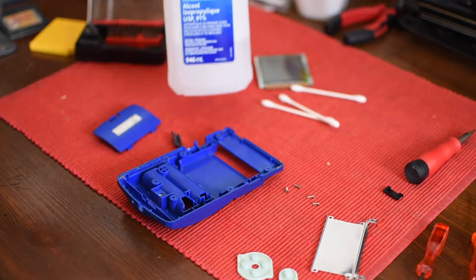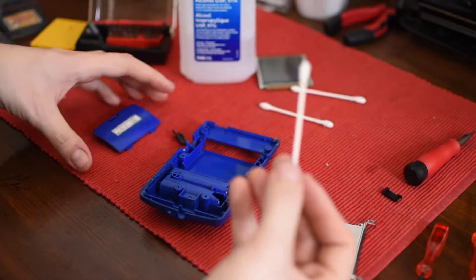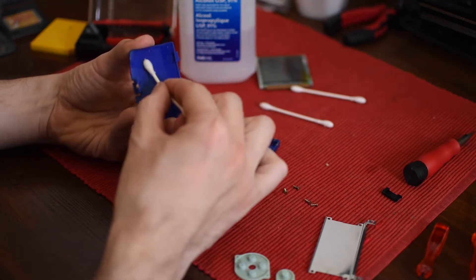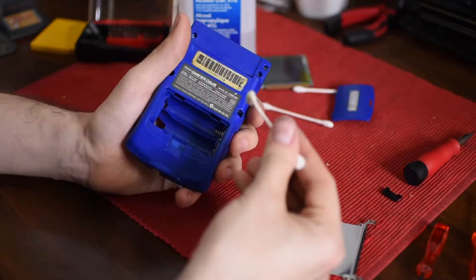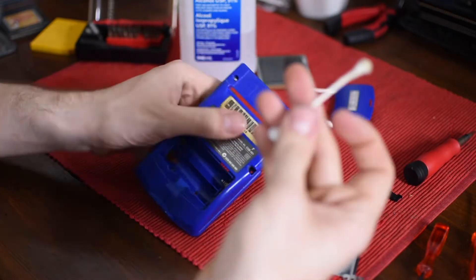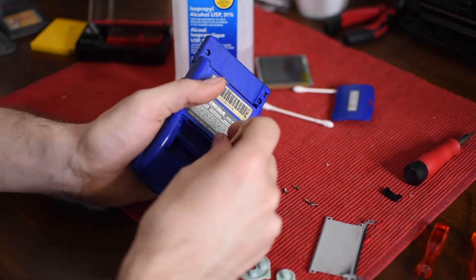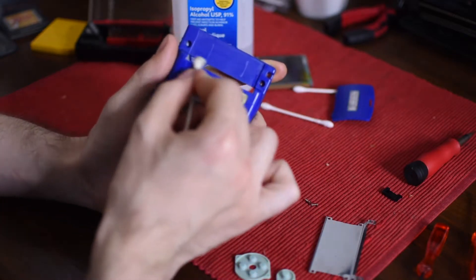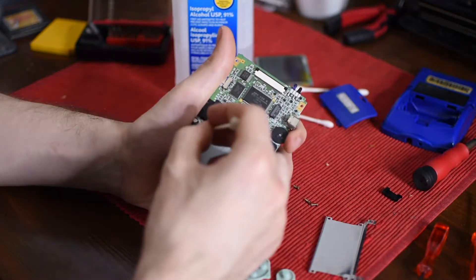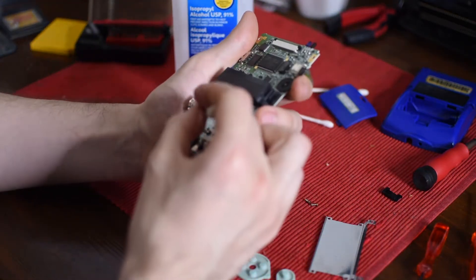While that's soaking, we can work on the second method. Just get some Q-tips and a nice bottle of isopropyl alcohol — the kind of universal cleaner when it comes to retro games — and just work it through to clean up all the gunk. I did mention the issues with the battery terminals looking a little corroded, so get a little bit of isopropyl and clean and polish those up as best as you can. Hopefully this could be a good step in solving the Game Boy turning off problem. I'm also going to clean up the battery parts that are on the board itself.